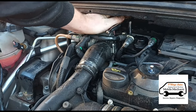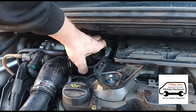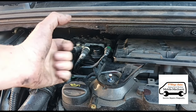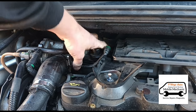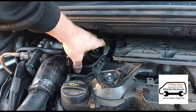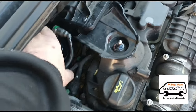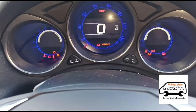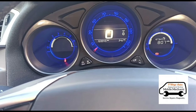Get the 8 millimeter bolts back in and tighten them up. On top of the filter you'll see a little black push-down primer pump. Normally I'd disconnect one of the hoses and use my own hand primer pump to get the fuel up, but if you haven't got one, just keep pumping this — it takes about five minutes of pumping and you'll feel it get stiffer as it's done. Start it up, hold the revs at about 2000 RPM for about 60 seconds just to make sure there's no air in it and it's not going to cut out. Once happy, switch the engine off.